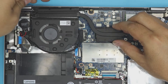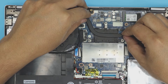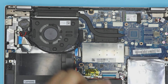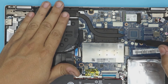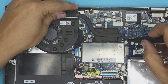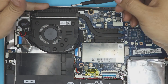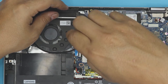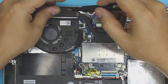Grab your heat sink, align it, and once you put it down don't lift it up. Place it right there. To put the screws in, you can go in a cross-stitch pattern or follow the numbers — there's a number one, two, three. Go the way it says, but I prefer to hold it from one side and put screw three in first, holding it with my pinky, then put screw two in, then screw one. This balances the pressure so I do three, two, and one while holding the heat sink in place.